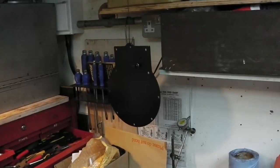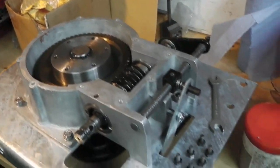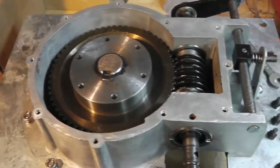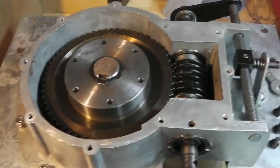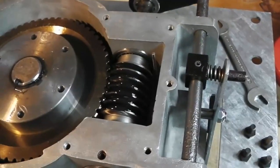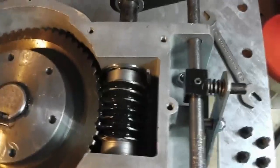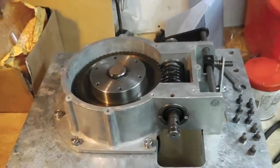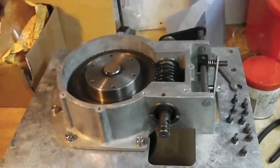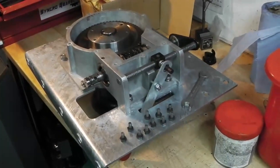I've got those bits and pieces for the winch painted, so I'm just doing the final assembly on the winch. I still need to find a fair lead roller for it, but that's an easy bolt-on afterwards. I've just installed the winch bollard drive gear - put that in the case first, then lifted the whole unit over the winch bollard, put the key in, screwed up the circlip. I've used some graphite grease on the gears, which seems to work very nicely - hangs around and helps it all bed in nicely. I'm going to put the cover and gasket on, then the starter dog, and that's as much as I can do for now.